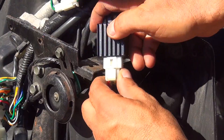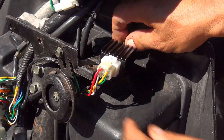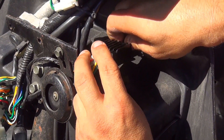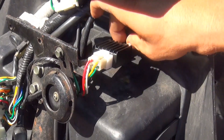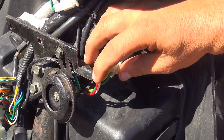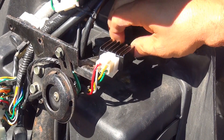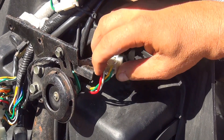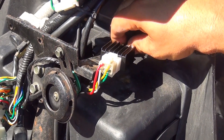Now place the bolt back in, starting it by hand first, then tighten it with the 10mm wrench. Try to make sure the wires are not touching anything, not too tight against anything, because when you are riding your scooter it will slightly move and these wires could be damaged or cut by any metal parts nearby. Keep the cables away from any sharp parts.